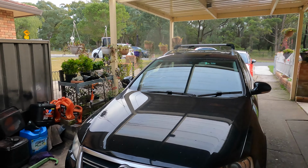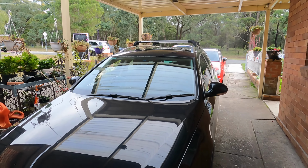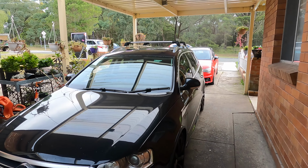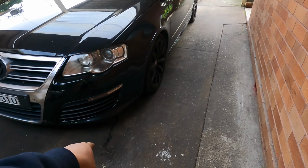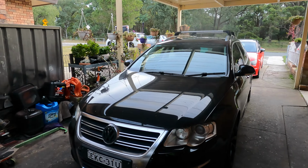This is the way Simon does it. Doesn't matter, have to be VW, even Toyota, Honda, all the same. Even Lamborghini, all about the same, okay? The sunroof is the problem, so you better check that one. The first key, 90% is from blockage from the water catcher and the water line that goes in and out here. That's what happened to this car. So this is 100% fixed.